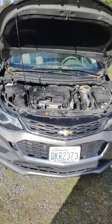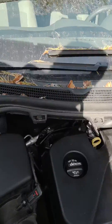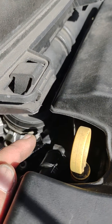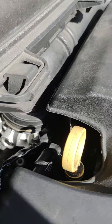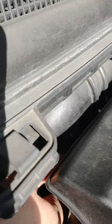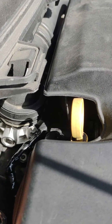We're going to talk about a P2101 code. What that's telling you is that your throttle body position right here is not seeing signal. When you diagnose one of these, there's a connector in back here that you can see right here.